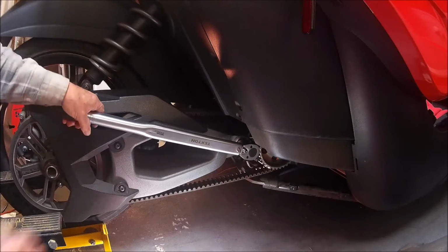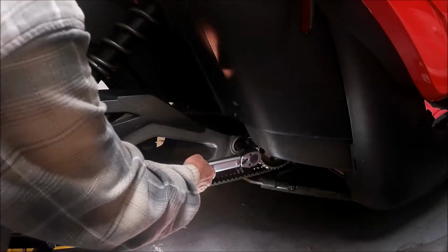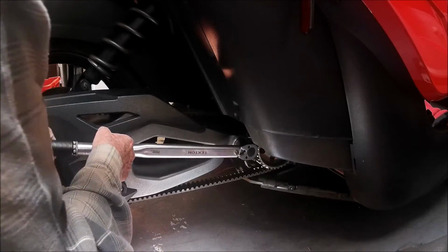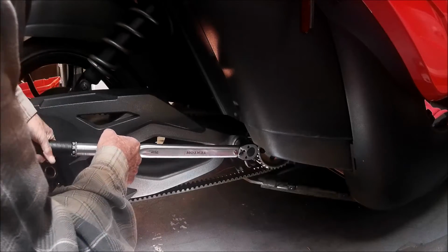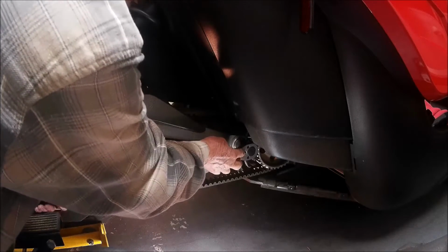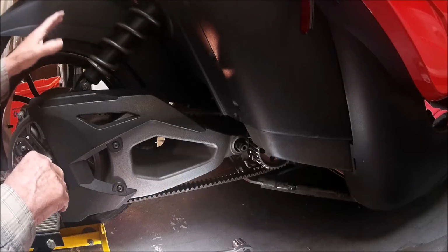Now I'm going to adjust my torque wrench to tighten it up at 20. It's loose. Now we're going to tighten it up. I have it set for 25. Okay, see, it's moving. And I'm going to listen for the click. There. Okay, that's 25. I'm going to take off just a little bit to estimate 20. Right about there. Okay, we're ready to make our adjustment.